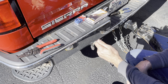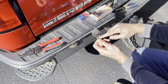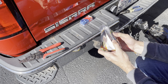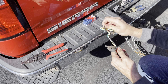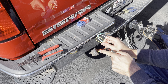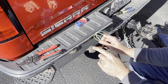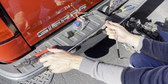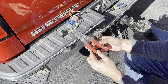Now that we've got those tabs out, it's time to replace our four pin. If you've got your old four pin, hang on to it — check the color of the wires. Take your replacement four pin; I got this one from O'Reilly's. The first thing you'll notice is that these colors don't line up, and that can be a problem — you can get confused and connect to the wrong one. So connect these one at a time from the new one to the old one, and just do it one at a time so you know the correct line is going to the correct place.